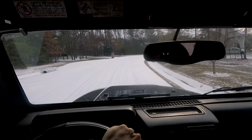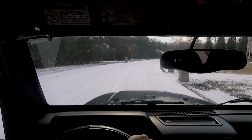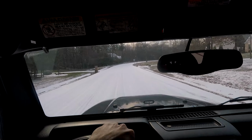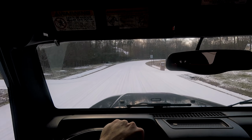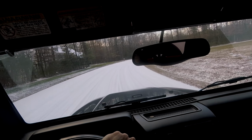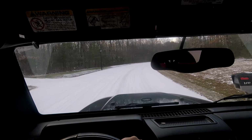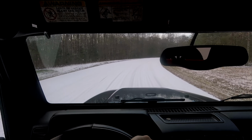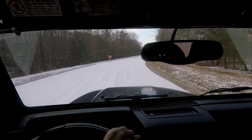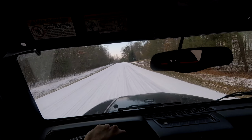All right, so this is the first drive. Let's see, what did I do? I did a DPG Off-Road Ultimate TJ kit, and that's a roughly 2.5 inch suspension lift. It's all Old Man Emu and JKS components, and then I have a 1.25 inch body lift, so about 3.75 inch lift overall, 33 inch tires.